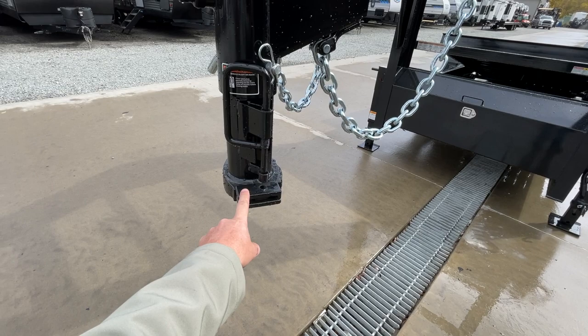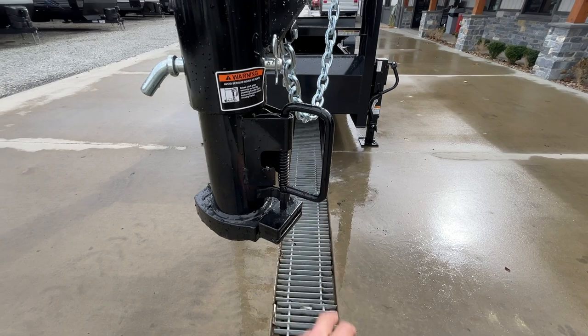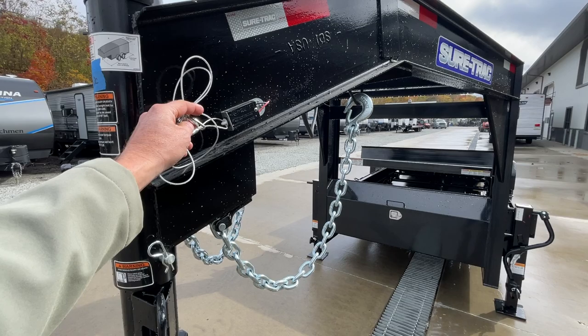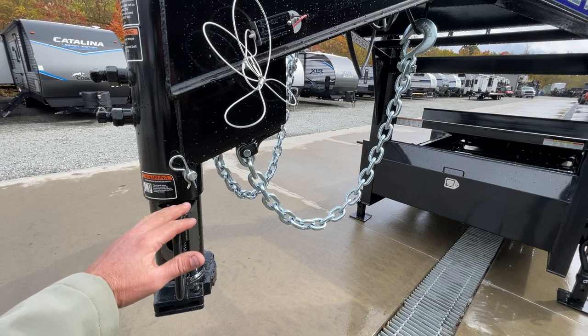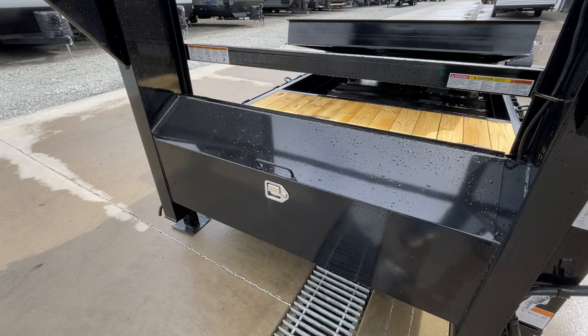Of course, your safety chains with your safety chain holder. Like 99% of the ones in the market, this has your traditional two and five-sixteenth inch gooseneck coupler. If you've never had a gooseneck before, it is spring loaded and then you just set your pin. Two set bolts on your neck give you your torque spec and max capacity. It's got your traditional safety breakaway cable hookup. You do have four different neck settings, but this is set standard for stock height on most every pickup truck — it'd be fairly unusual to have to adjust the neck.